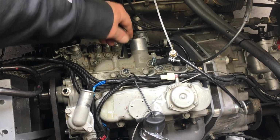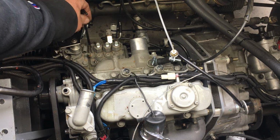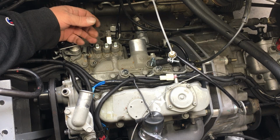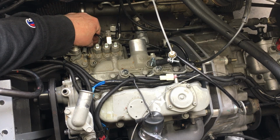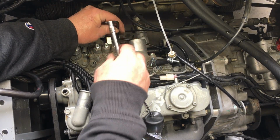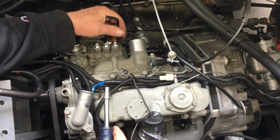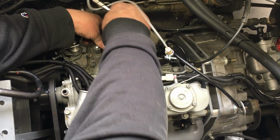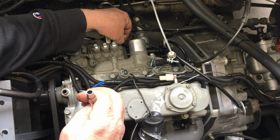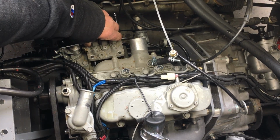Now, the dangerous game we're playing with this engine is we're allowing it to hit 1400 degrees Fahrenheit for a few moments. Now, keep in mind, when the exhaust gas temperature hits 1400 degrees Fahrenheit, it still takes time for the heat to penetrate the pistons and to reach the piston rings, and it's the piston rings that we are primarily concerned with. You see, the piston rings on this engine are not properly gapped to function at 1400 degrees Fahrenheit, and if we ignore all the warnings, well, the piston rings will expand from the excessive heat and cause serious engine damage. I think pretty much in every video we focus on the exhaust gas temperature as we tune this engine for more power at full throttle.